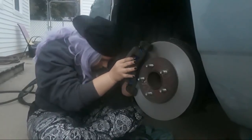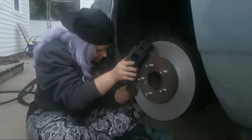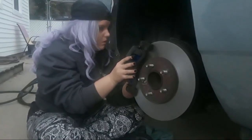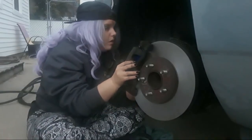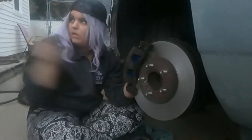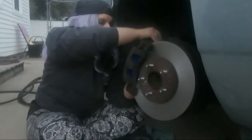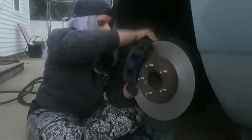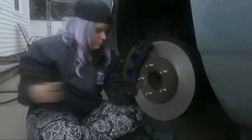Now push your bottom pin in so it'll slide into place. Come on, push the bottom pin in. I'm pushing it in. Shut up. You're not, because it's not going on. Yeah, there, now it's going on. All right, now you want to line up those bolt holes. Yeah, they're lined up. And here, take one of the bolts, start the top one first. Got that one started? Yep. Here, get the bottom one started while it's still loose.